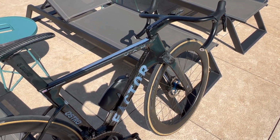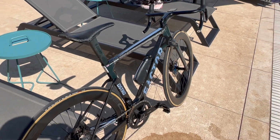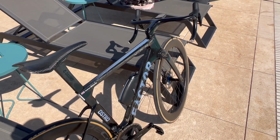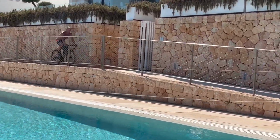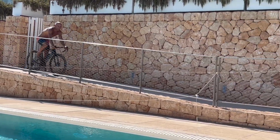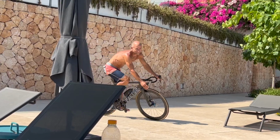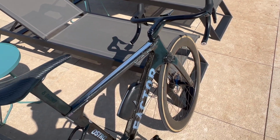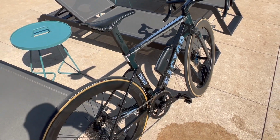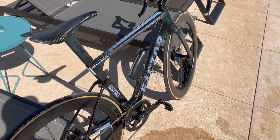So you know, I've had this before. If you look at my previous video on the Mallorca 312, I had it then as well. Had a full brake service end of April. It lasted about a month or so before getting very squidgy again, and you just never knew what kind of brake power you're going to have on each different ride. And they've been bled so many times, these brakes, and I can't be doing with that really. You can't descend like that with the brake feel different every time. And even the power is lacking as well.